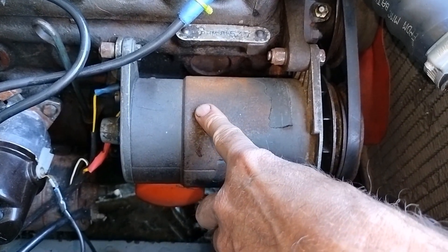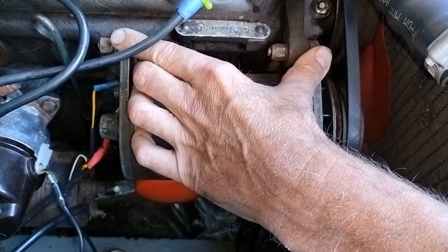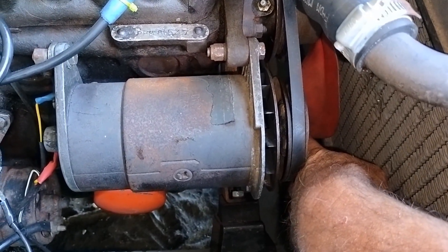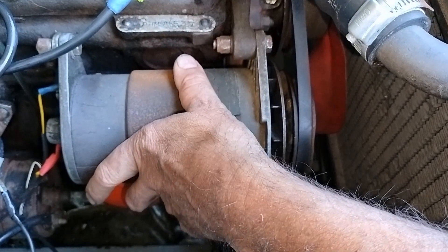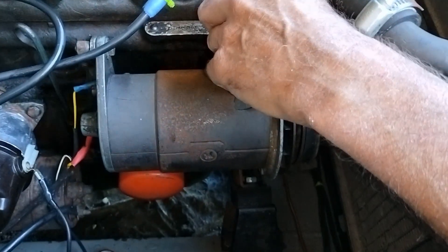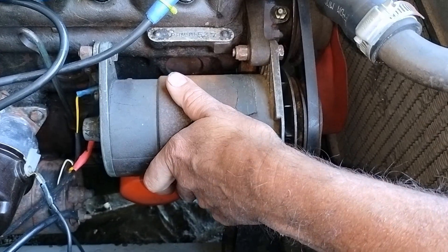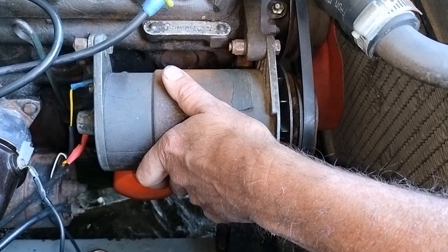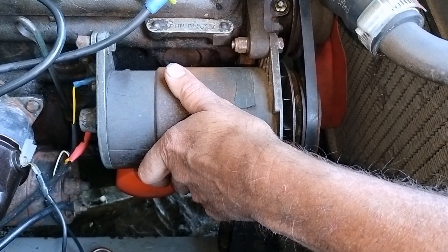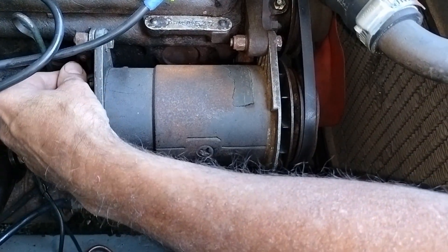Here on the left hand side of your engine block, as you're looking in from the front, is your dynamo. It's strapped to your block with two bolts at the top holding the heavy dynamo onto the engine block and one more bolt down the side on your adjuster slider. What it does is take mechanical power from your engine block and turn it into electrical power through coiled copper wire and magnets which spin round and connect to a commutator. The commutator is then connected to two carbon brushes which pick up all the electrical current.